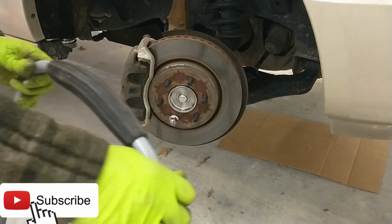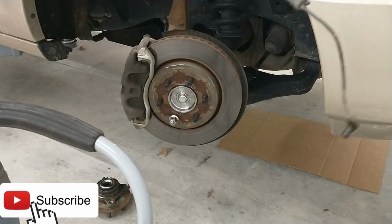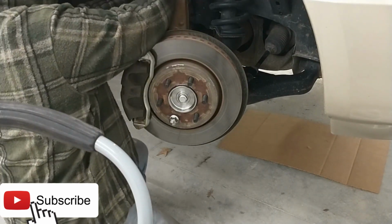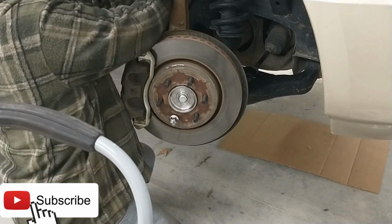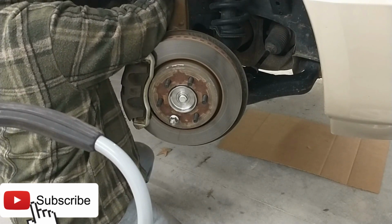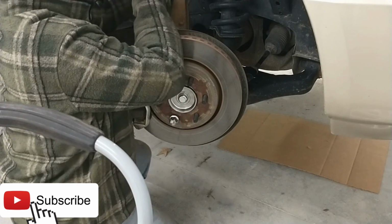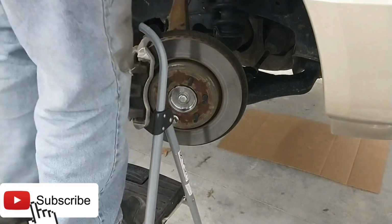And then we'll pull out the old ABS wire. There it is. Oh, it's a snake. And we'll snake the new one right up through where the old one was routed, because that's the way Ford engineers figured that it was the safest place to be. Make sure you put your little Christmas trees back where they go. And go up top. We'll plug her back in.